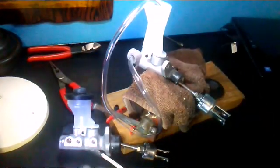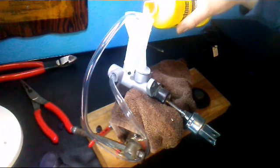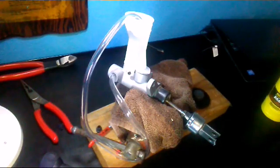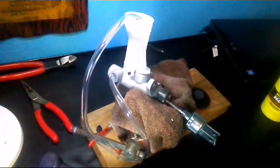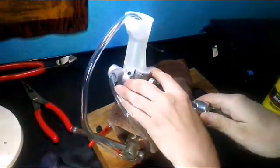So what we're going to do is fill up the master cylinder with brake fluid — I'm just using a DOT 3 high temperature synthetic fluid. You can see those bubbles bubbling up — that's a good thing, it's already doing its job being sideways. We want to see all the bubbles get out; we don't want to see any air bubbles whatsoever. So let's get to pumping.